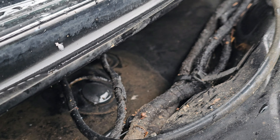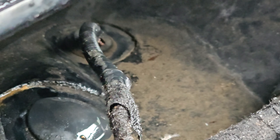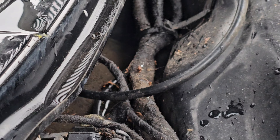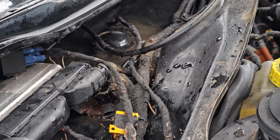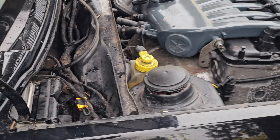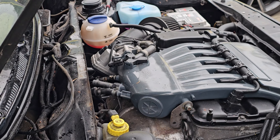We've actually got a whirlpool going through that grommet — it's drained down now. So there you go — that is the cause of quite an extensive water leak, at least into the driver's footwell. I think that just needs a new, better grommet really. And a good clean up. I'll clean all these leaves up because they're just asking to block up these drain tubes and then you're in more of a world of pain. And there's an ECU cover which you want to keep dry.